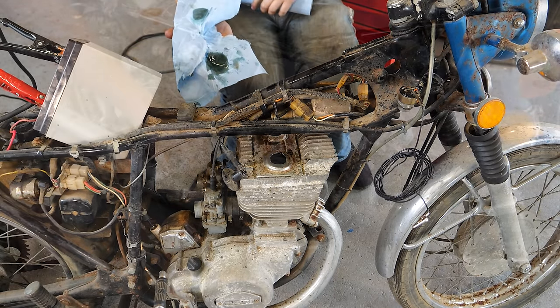There should be an inlet here and an inlet here. This one is your on position inlet, which sits a couple inches above the bottom of the tank and only drains the fuel to this level. At that point, you change it to reserve, and you will pull the fuel from down here, and now you can burn that last inch and a half of fuel, last gallon that's in your tank.